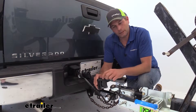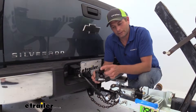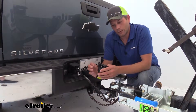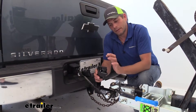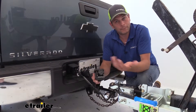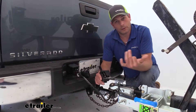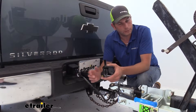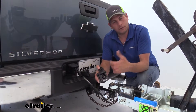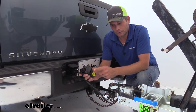We've got completely covered springs here that protect them from the elements, so we know our door is going to work out really well. Gaskets inside are going to keep moisture from getting in. You'll notice we've got a five-flat connector here now, so this can be used as a four-flat adapter or a five-flat adapter — with the five-flat you're adding a reverse signal, which can be used for surge-style couplers for the electric lockout, or to run reverse lights on your trailer for illumination when backing up. And it's going to have the six-pole plug to take care of any six-pole round connection.